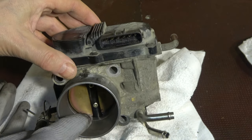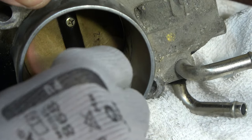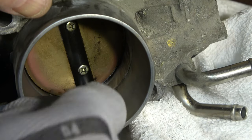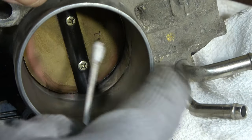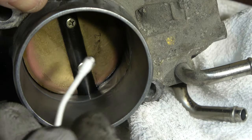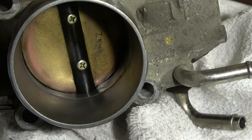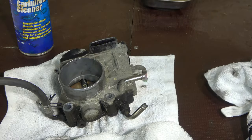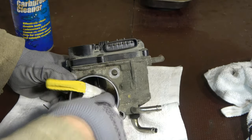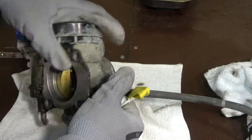Let's look closer at how I clean those areas. Taking this cotton bud, I can reach very sensitive areas. When the white tip becomes dirty, I can see that I have found something dirty there. I continue that job, then open the throttle valve, insert the cotton cloth inside, and rotate the valve again.